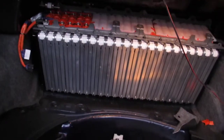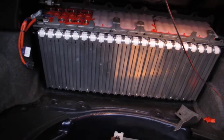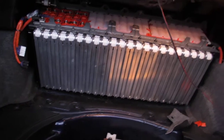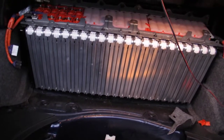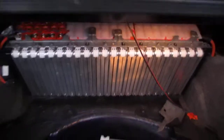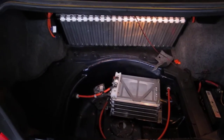I just don't want to take any risks with charging as well. I want to have proper cell monitoring so that I can shut down a charger if a cell goes too high or if a cell goes too low. I want to open the contactors if the cells go too low so that you can't continue discharging. Okay, that's pretty much everything for now. I've got to get this certified soon, but until then, I will see you later.